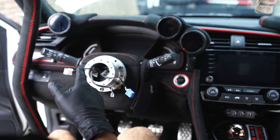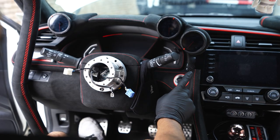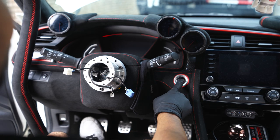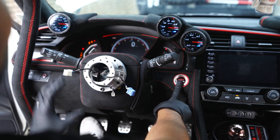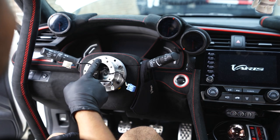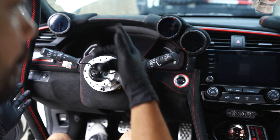Go ahead and put the negative terminal back on the battery. You don't need to start the car — just go into accessory mode. I didn't even have to go to the second click; as soon as I pressed it the first time you could see the steering wheel re-center. So now that it's straight, I know it's going to bolt in properly. Now we can disconnect the battery again.